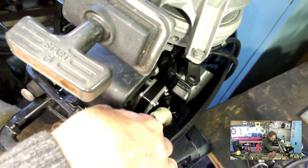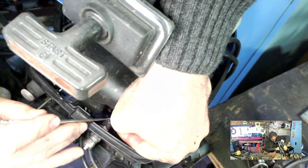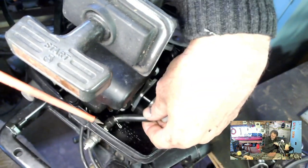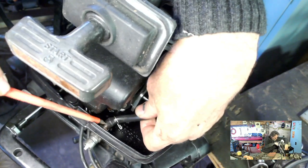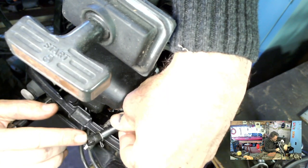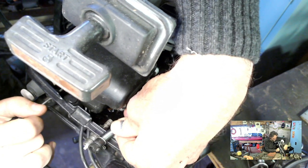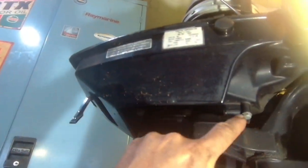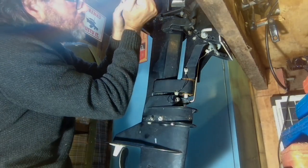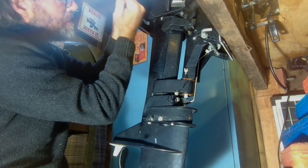Fuel — there's a simple little hose clamp here. They're actually really fiddly, these ones. The hose has split a little bit — I've got some round hose pliers which are a much better tool — but I think we've got more than enough slack to cut the last little bit off and get some fresh hose so we don't have a fuel leak inside. Under here we now have three bolts each side, so six bolts total to take the powerhead off — little 10mm heads on these bolts. They're not feeling anywhere near as corroded as the cylinder head bolts were, which is nice.